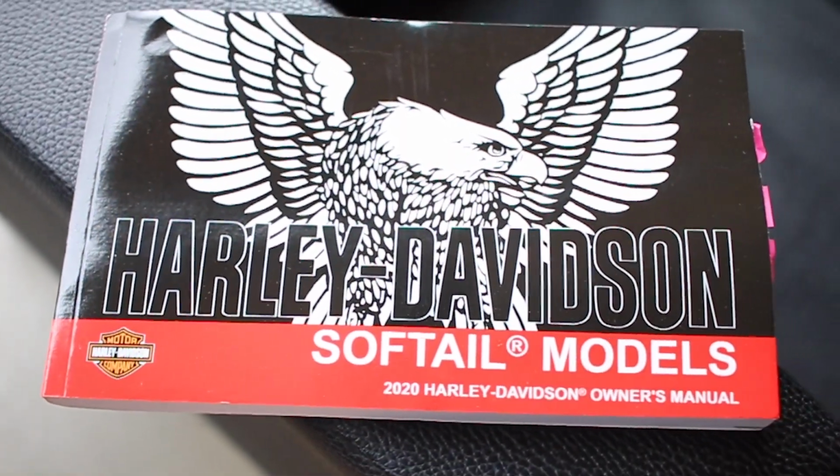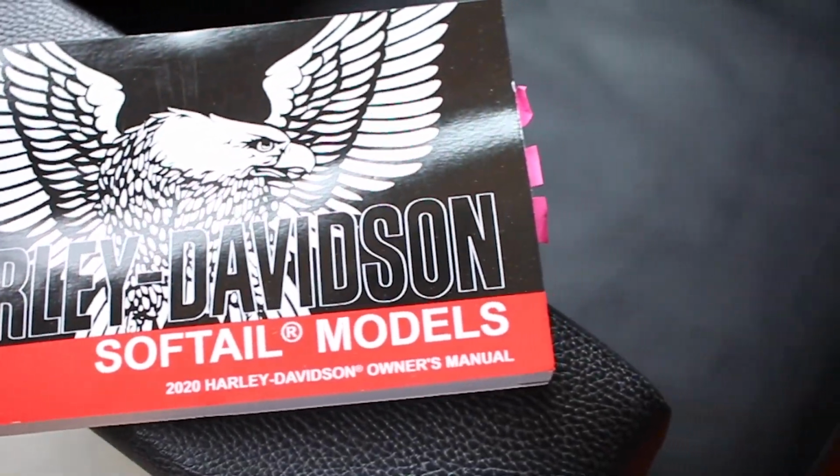That being said, what is the proper tire pressure for your Harley-Davidson? There are two places you can find it specifically. Number one would be the owner's manual, if you still have it. There's a page that gives you the proper inflation for solo rider and solo with passenger or additional gear. The other thing you always want to know is that you are setting the tire pressures cold. Harley defines cold as a vehicle that has not been operated in 4 hours.